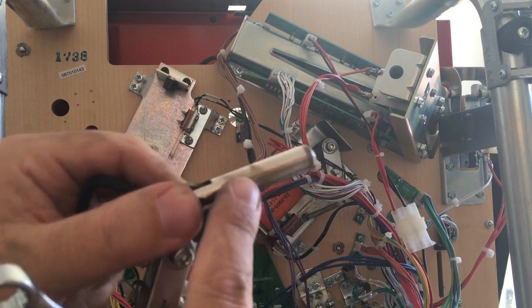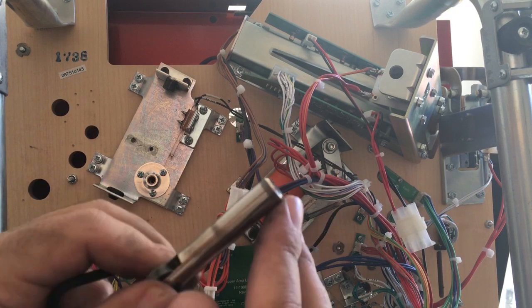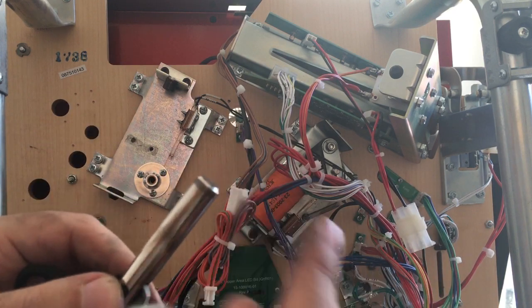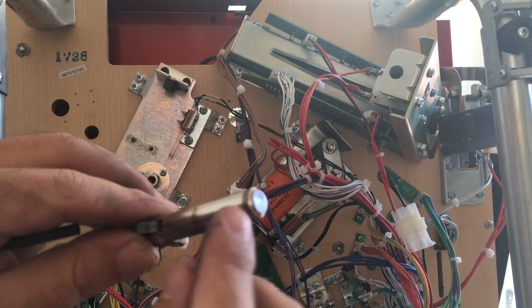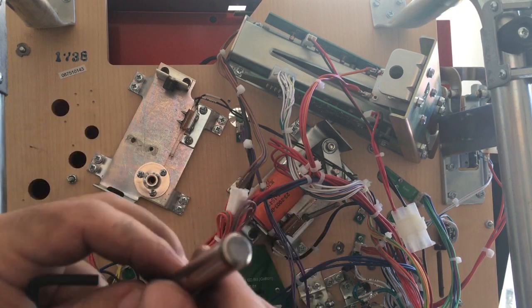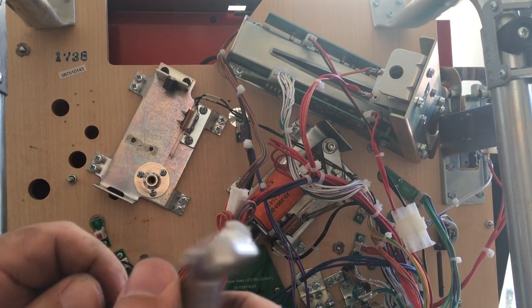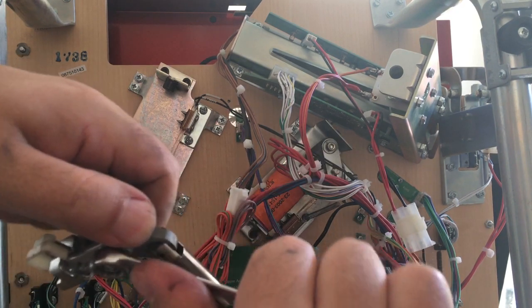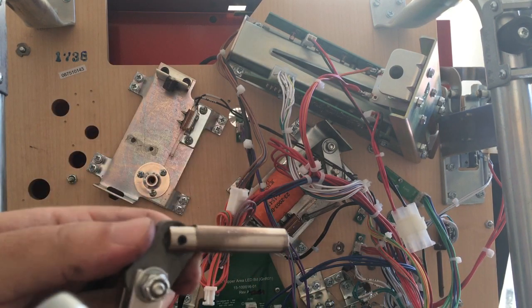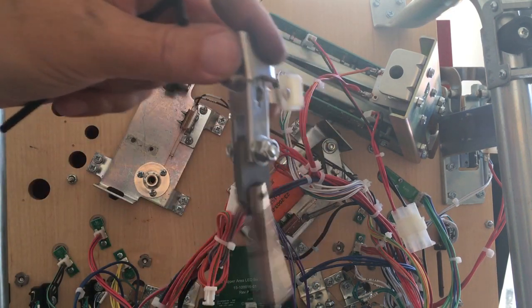And in the meantime, see if it still has this 45 degrees angle, or if the head is mushroomed out, because that will lose a lot of flipper power. This one, I will replace it soon. I mean, this one is not that bad, but I would replace it, absolutely, because this pinball machine has been routed for a year, guys, and there we go. Super nice.